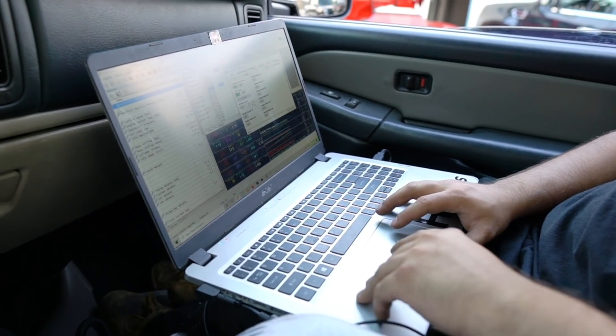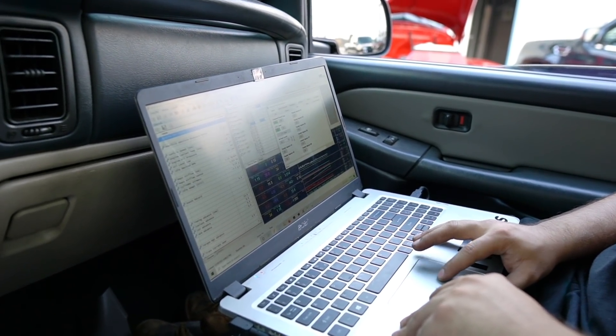The O2s are probably not working — it's at 450 and that's like their static number. And it's adding fuel and it's not responding, so I'm going to have to do everything with a wideband. More technical difficulties, but it's a fun project.